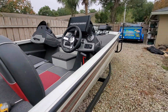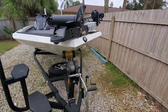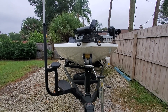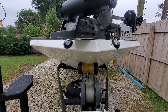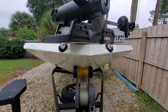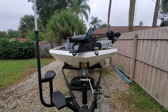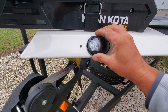The nav lights I installed on the front of the boat are LED, and the degree is actually perfect. From when I stand off to the side at 112.5 degrees, I can see it, so they're highly visible and they're acceptable.